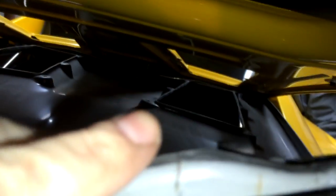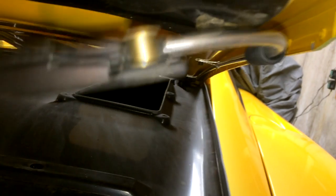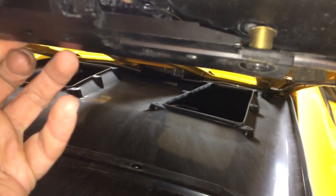Okay, so I've got this whole contraption removed on each side here, and like I said, I think these are hydraulic lines, I think anyways, and basically I've got the entire mechanism that used to rotate up and push up on the stock wing, which is now gone, by the way. But I've removed that arm, so I still want the car to think that the wing is here so it doesn't throw any check engine codes. So I'm leaving this whole system of hydraulic lines and stuff, whatever this is here, in place, but there's just no arm there, so it's not going to push up on the wing that's there now. So that's what I'm doing. I'm going to bolt this up here in a minute and just put it back where it used to be. Again, it's just that little arm that used to be there is not there anymore.